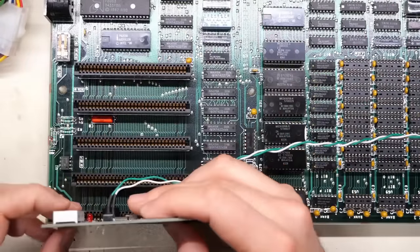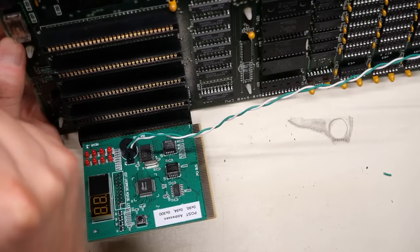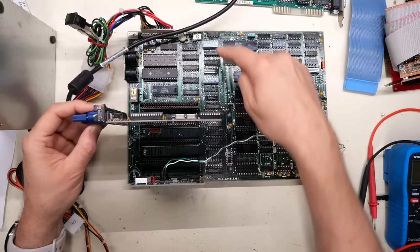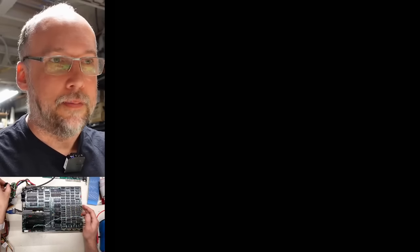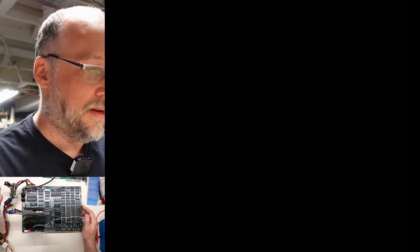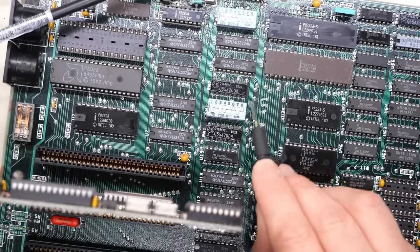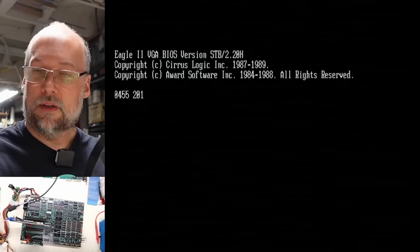The activity we're seeing is actually just activity on one of those other ports, but it's a good thing because it tells us this machine is actually working. Now let's plug in a VGA card. I'm going to assume this board is already configured for VGA or EGA since that's probably what the previous owners were using. Let's turn it on and see if we see anything at all. We're still getting the beeps. DIP switches five and six are for the video card — five is on, six is off, which I think is set for CGA 80 columns. Let me switch that.